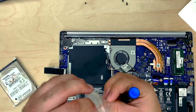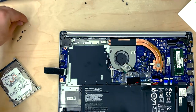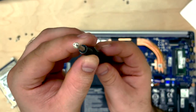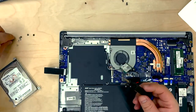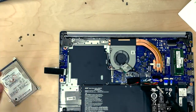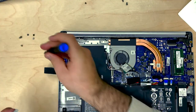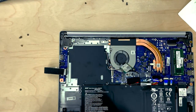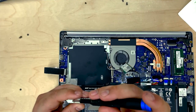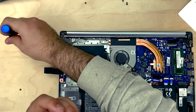Let's get these four screws in. We have eight screws in this little packet, but we're going to want to use the right ones for the hard drive, which are these thicker ones — these are for the hard drive bracket. The much thinner, smaller ones are the ones you're going to want to use to actually attach this bracket inside the machine. It really helps having a magnetic screwdriver in a situation like this — I'm actually using my iFixit toolkit. Let's get all four screwed in.